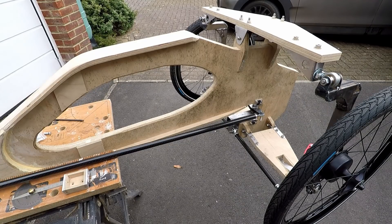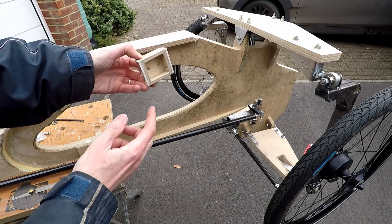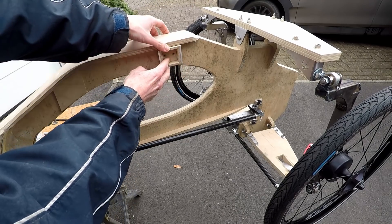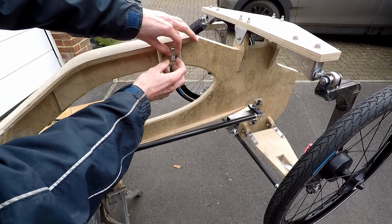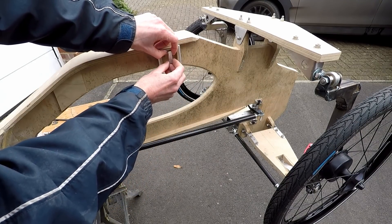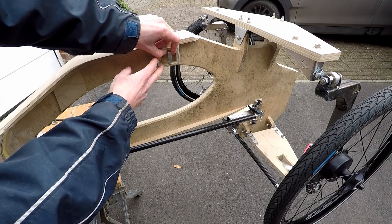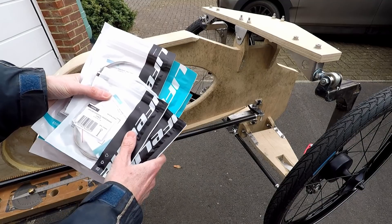One of the next jobs is going to be to sort out the front brake cables. I'm going to have the cables operated by a single brake lever so I need a splitter box. So I've made this little box which is two aluminium plates drilled and tapped front and back. That's going to be mounted about here. The brake cables are going to enter from the back, be split into two using that little thing, and then two brake cables will exit here — one to the right wheel, one to the left wheel. So this is just a sort of balancer so that will make sure that the cable tension is equal on both the left and the right wheel. I've got a pile of brake cable outers and inners that I'm going to use to rig that up, so that will be one of the next jobs.